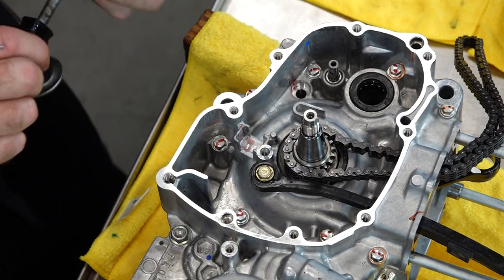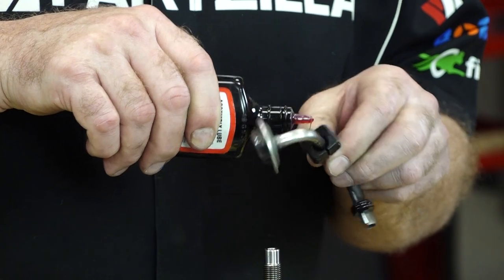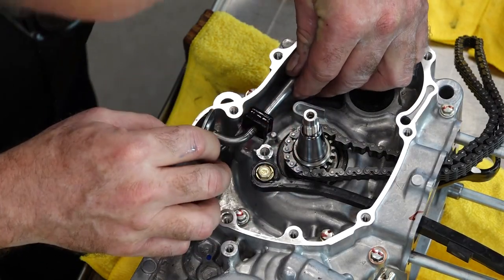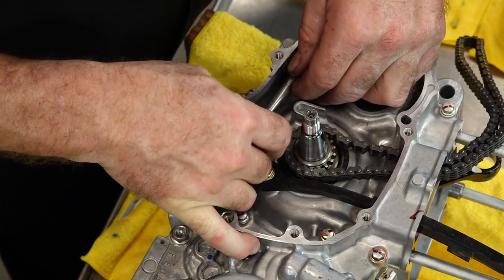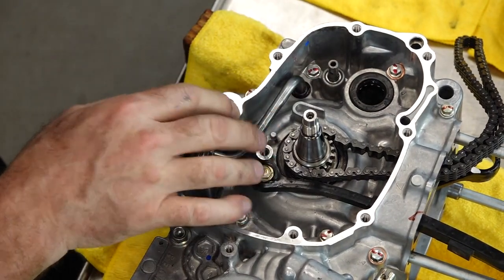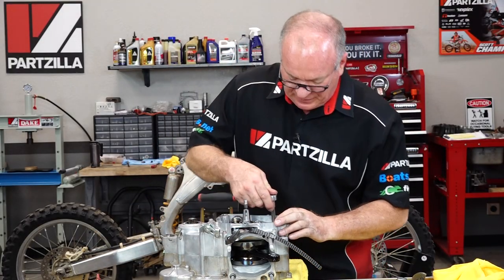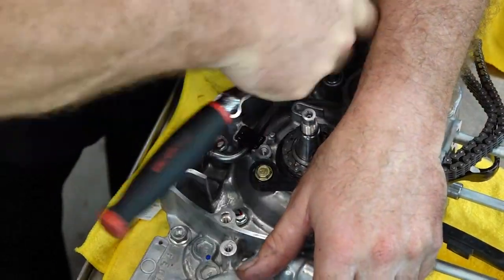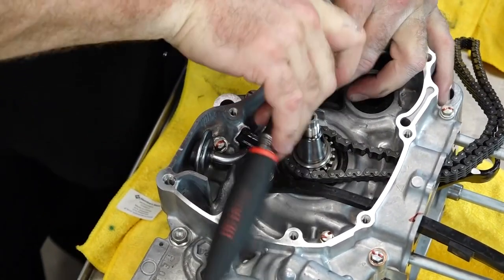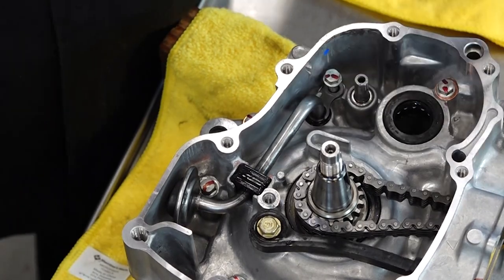Next, let's get in our pickup tube and do a little bit of assembly lube on both this little O-ring and this holder up top to make it a little bit easier to install, because these definitely need to seal up correctly so they need to go in smooth. Now there's a plate up top — one of the block bolts I'd already torqued down has a dual purpose. There's a plate that holds the pickup tube — very important. So we're going to extract it, get that plate in, and then re-torque it. That little guy locks around the tube just like so.